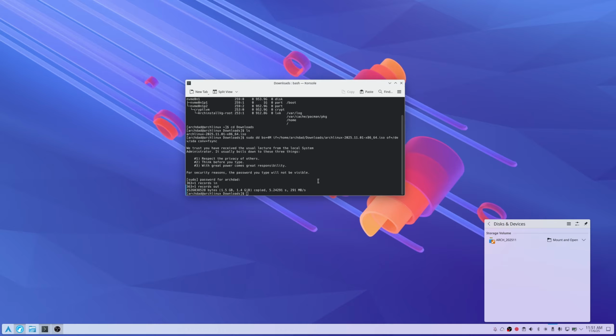I can't record this because the recording software just doesn't give me the option to do it. But what you need to do is find out how to select the boot menu when your computer starts up. So quite often when it boots up, it's going to very quickly say, press escape, press F2, press F11, press delete, something like that to get to the boot menu. Quite often it comes up so fast that it's hard to see, so you might have to do it multiple times, or search is your friend. So try and search for the option for your particular computer on how to get to the boot menu. For mine, it just happens to be escape. It's very easy to remember, but for you, it could be something different. So shut down your system.